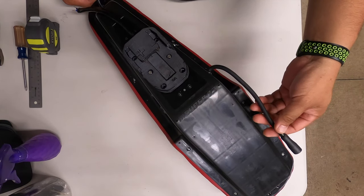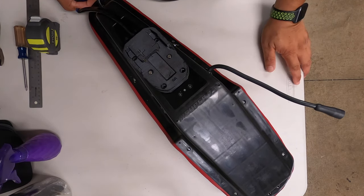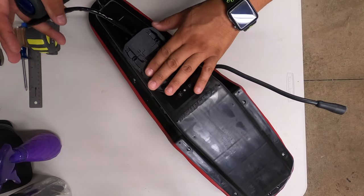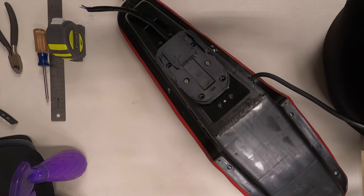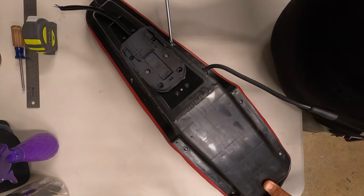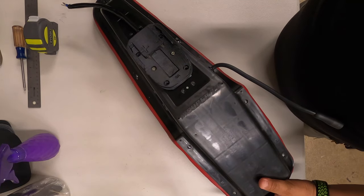There are going to be a couple of ties on the left side of the bike going to the back tire or the hub, and then right up the middle of the seat going to the front of the bike. There are going to be a few cable ties up there you'll have to snip as well. Don't mind this — this is my battery hack, we'll get to that another time. Next, there are going to be seven screws to take the seat apart from the battery casing.